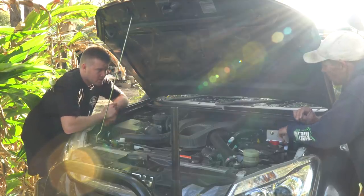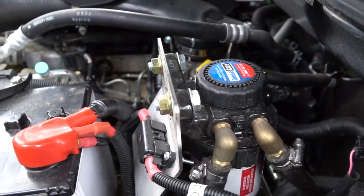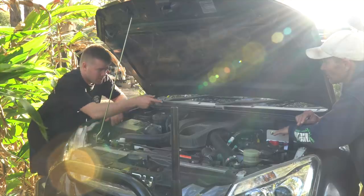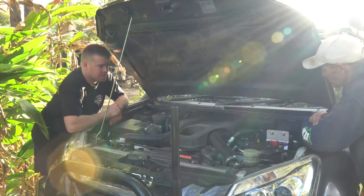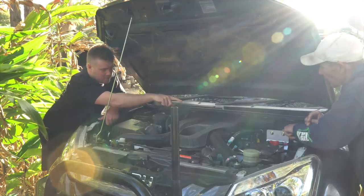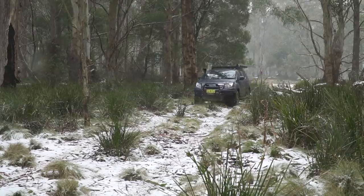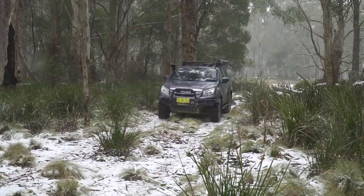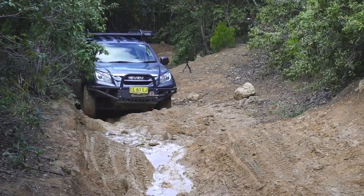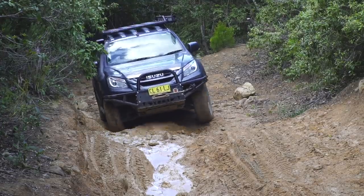And then a secondary fuel filter, a safety mechanism against polluted diesel. Do you know whether that's pre or post factory filter? Pre, I think. Fuel tank to that? To your main one, to your engine. Yeah, as I understand it. Now, that's a bit of a debatable topic of whether to do them pre or post factory. There's arguments for either side. Either one you go, you're going to be better off. You got your breathers?